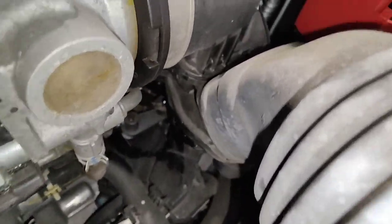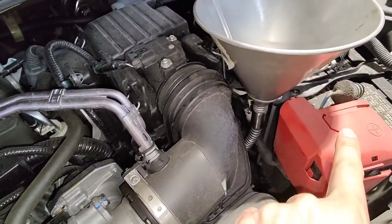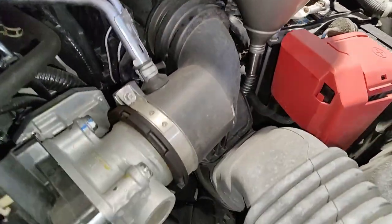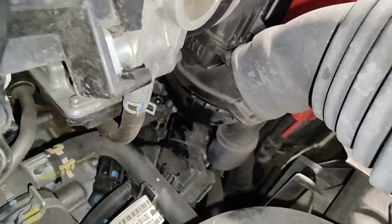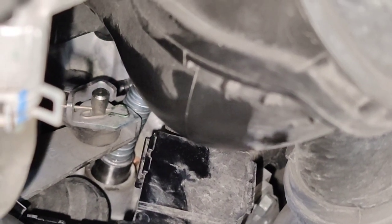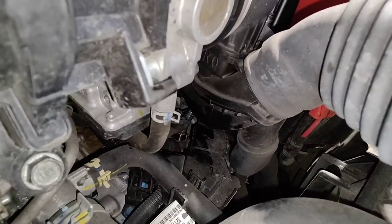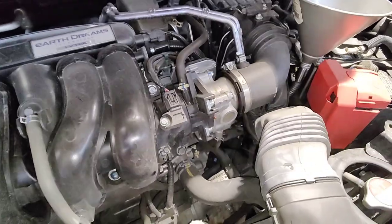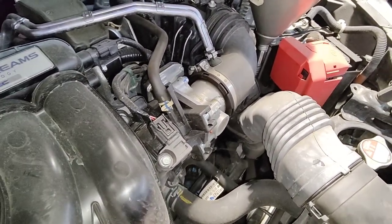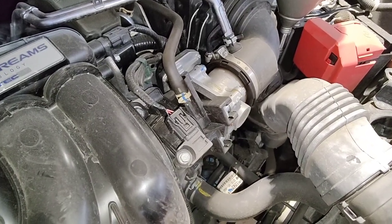It's time to fill it, and what I use is a flexible funnel. Make sure you don't touch the battery positive in case you don't have the cover — you're gonna short yourself out. Just run it and it snakes into that fill plug, and you don't have to remove the air box. How much fluid are you gonna need? About four bottles because it takes about 3.6 quarts. Usually I just dump all four bottles in there, and when you level check it, just drain the excess and you're done.